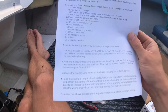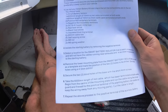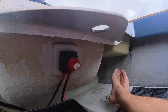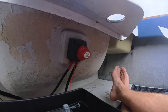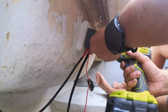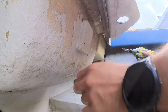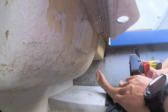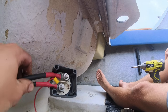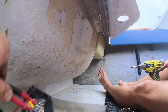Step three: select the location for the smart battery isolator that is easily accessible, will not have cables running near the exhaust, and is as close as possible to the starting battery. I'm going to try and get it next to the existing isolator. A couple of screws in this — nice and easy, that's removed. In my case I might reuse this mount. There is a spider in there, and anyone who knows me knows I'm terrified of spiders — hopefully it doesn't jump at me.